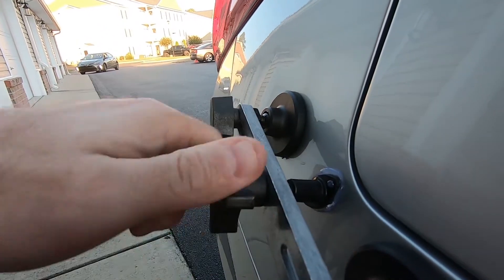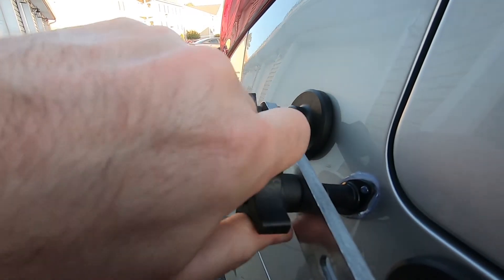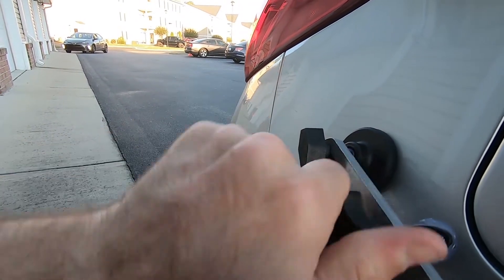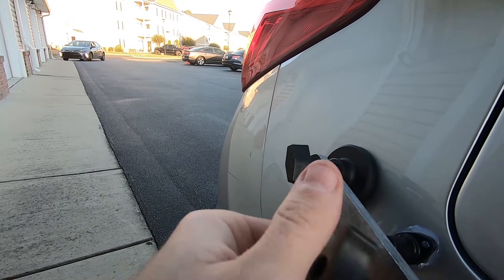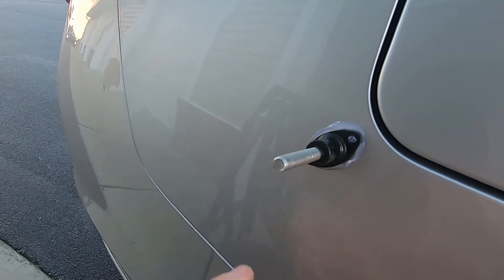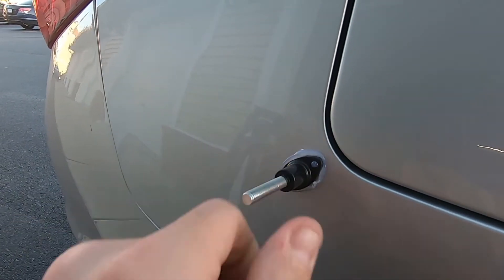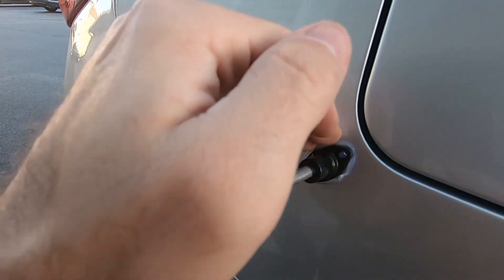I'm going to keep twisting and hopefully I don't damage it more than it already is. It's not separating but it's definitely pulling. I'm going to go ahead and release that pressure and see what we got. Notice how when I hit it now it's not buckling, it's not recoiling back inward — that tells me this dent has been pulled out. I just need to get this glue off to verify. To do that I need to get the release agent, run it back around the puller, and use the scraper that came with the kit to push in behind the glue and peel it off.